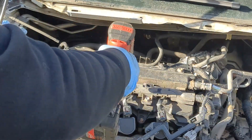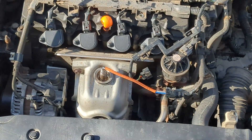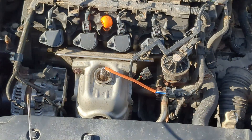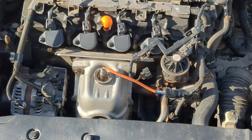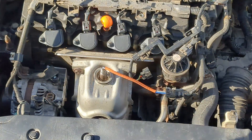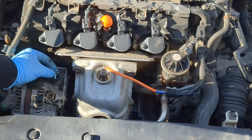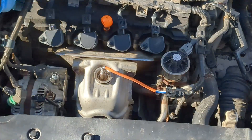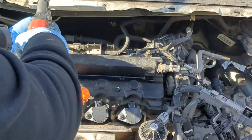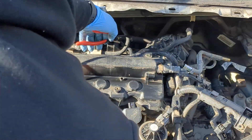Now I need to remove this wire harness that holds the wire for the ignition coil as well as the alternator. I will remove these two 10 mm bolts holding this wire harness in place. Now I will remove these connectors from the alternator. There is a 10 mm bolt here that I need to remove. Now I will remove this connector — having these special pliers come in handy, and I will put a link for these in the description below. Now I can remove this 10 mm bolt and move this wire harness out of the way. I will also remove the wire harness for the fuel injector — there are two bolts holding it right here. Now I will unplug this connector.